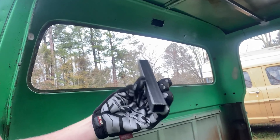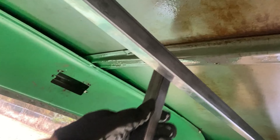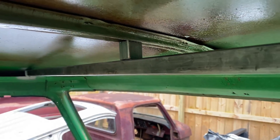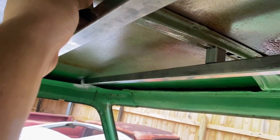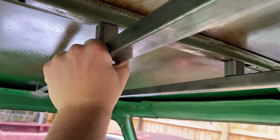My first step is going to be cutting this green truck right down the middle so that I have this fresh, rust-free-ish front portion that I'm going to end up putting on the crew cab. I'm also going to need this back half for the rear door stretching. So when I cut it in half and cut the floor out — since I'm using the 2016 floor — it would be all floppy and flimsy, so I'm trying to weld some support in here.